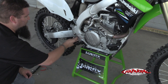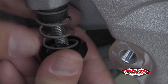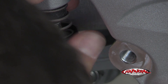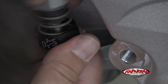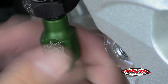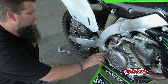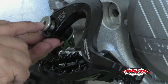Next, you're going to slide the Hammerhead spring over the boot and the plunger rod just like that. Then you can thread the adjustment cap onto the plunger rod — go about halfway up to compress the spring, which will give yourself some movement. Start spinning it; you can throw a wrench on the nut up there. You can thread the clevis onto the plunger rod next, getting it a good ways up to give you some room and get lined up so you can get the brake lever in there. You're not going to be using the stock return spring because we've got the Hammerhead spring in here.